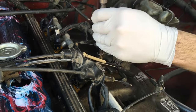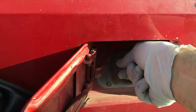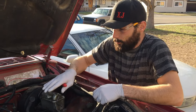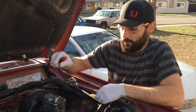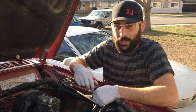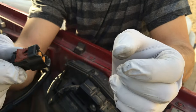Go ahead and take these out. At this point, you want to go ahead and vent the gas cap just to relieve any buildup pressure. Now that we got the gas cap removed to relieve any unnecessary pressure, what we're going to do is actually remove the pigtails from the injectors. Now there's two different styles. For those of you that go up to a 1998 model year, you're going to have these square styles where they have a little metal retaining clip — easiest way is to use a pick and just move that retaining clip out of the way to then remove the pigtail. For those of you with the 99 and up Cherokees with the 4.0, you're going to have something that looks like this where you have this red clip — you're going to have to actually pull it back to release and unlock it, and then you can pull it off the injector.